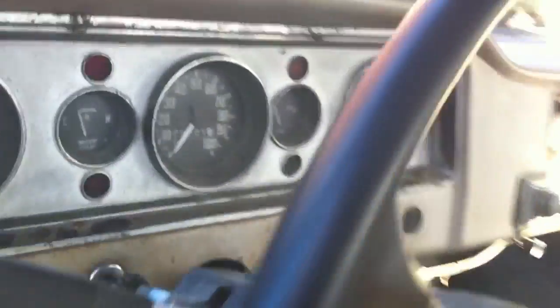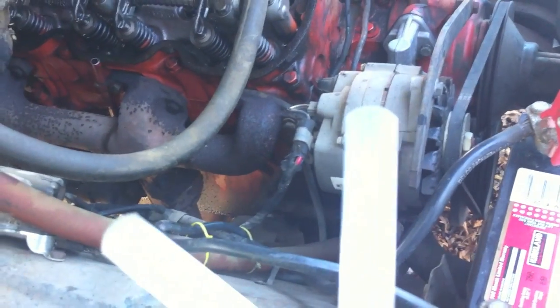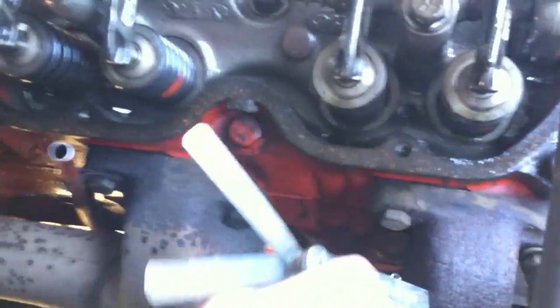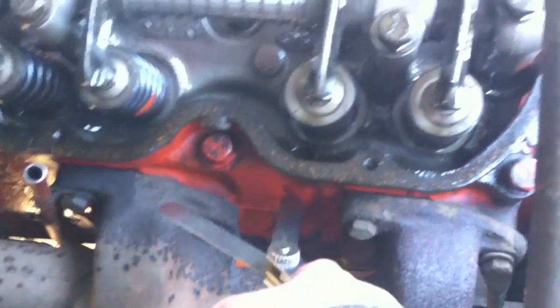What I'm going to do is come in the truck and shut it off. The two gauges you're going to need: 12 thousandths on the intake valves, and 18 thousandths on the exhaust. How do you tell the difference? Here's the top of the rocker arms — look down here, see that? That's the exhaust, that's lined up with this valve — that's the exhaust valve. Where's the intake valve? Here's the runner coming in — that's the intake going to this valve. Simple as that.